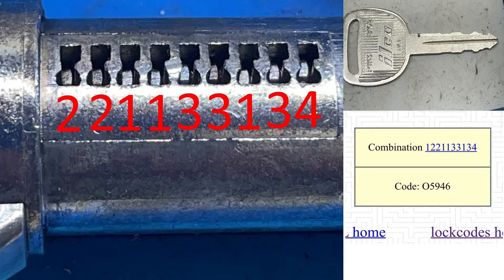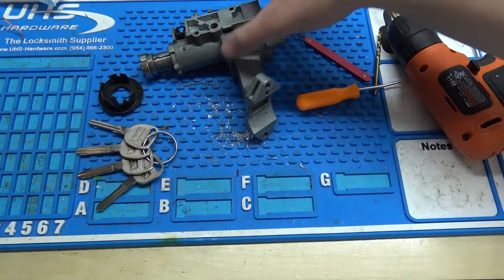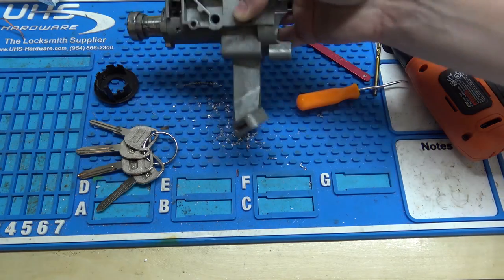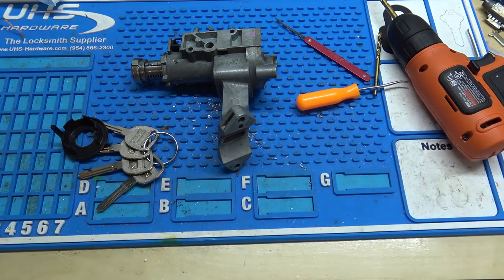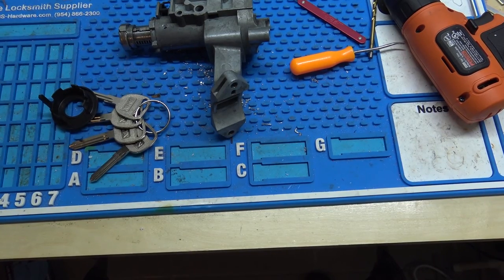That looked a lot harder on camera — just trust me, because the tripod's in the way, this really isn't that bad. And once you've made your key, you can even replace the cylinder if you want to, whatever you want to do. And then it goes back in in one position. I'm actually not going to put it back in yet because I do want to make a key to it. But once you've made your key, put it all back together, slap it back on the car, and it's actually pretty easy money. These aren't real hard to deal with. You just have to drill your hole for your sidebar, and making the hole a little bit bigger so you can actually see the retainer makes it a heck of a lot easier. If you guys have any questions or comments, put them in the comments, and if you like this stuff, subscribe. That's really all we got for now. I'll talk to everybody later.